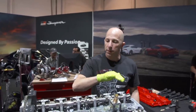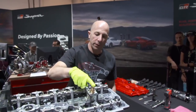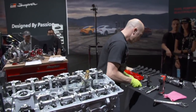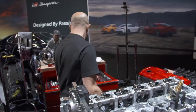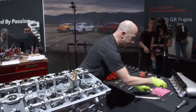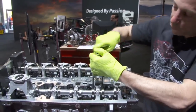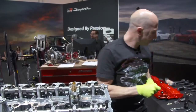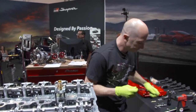Okay, so now that the exhaust cam is all bolted in, except for the one main cap that I can't get to here, I'm going to release the tension on these exhaust valves with the 19, or the 17, which I did not put back, which should be right there. So now we'll take the special service tool off of the exhaust cam lobes there, and then unbolt it.